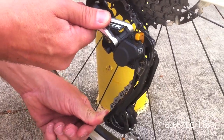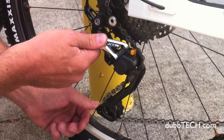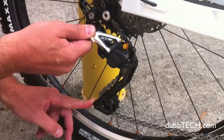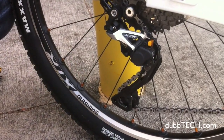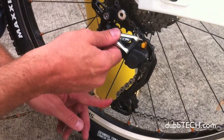The derailleur is still able to move, but it's a one-way friction pivot that slows down that cage substantially, so it doesn't affect shifting hardly at all. It's a tiny bit heavier going up the cassette, but the parallelogram and the shift indexing is still unaffected.